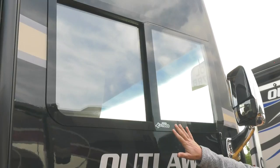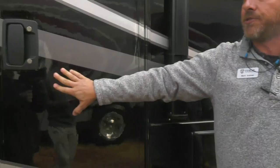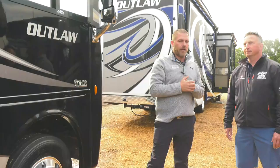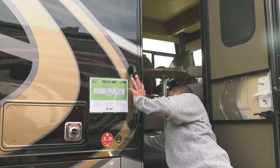Moving down to the frameless windows — the beauty is that the sill isn't exposed to UV rays. Everything in this coach sits on aluminum studs. The only thing not framed in aluminum is the electrical outlet right there, because if you loosened it and hit aluminum it would send current through the sidewall. Most RVs just route around openings and use the window as framing; we go in and put studs in all those openings.